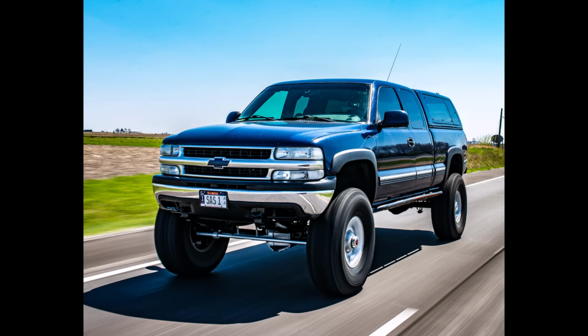So the part that I don't like about the 14 bolt is that each axle shaft is a different length. So you have to carry both, or you have to get a custom shaft that's got super long splines. You can cut it off, which I might do someday. Also, they're not the weakest point. But I try and run 1410 U-joints on the whole drivetrain, so I only have to carry the one U-joint. Only carry one stub shaft for the Dana 60. Obviously, you have to carry both inners.